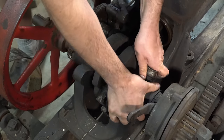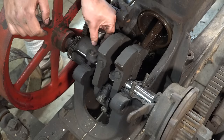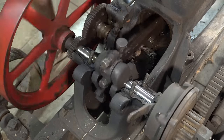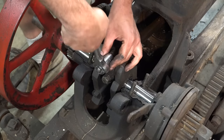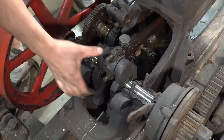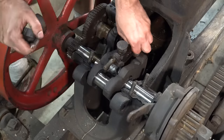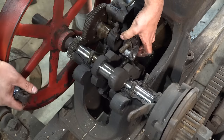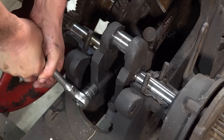I don't deal with four-stroke engines very frequently on this channel, so this is kind of a first. These are the Babbitt bearings — you've seen me pour Babbitt before in the Saw Filer episode. The actual crankshaft is in fantastic condition: beautiful, still shiny, no rusting, no scoring. The Babbitt bearings on the connecting rod area have a lot of dirt and dust around them, but also seem completely fine. Crankshaft is glorious — very excited about that.